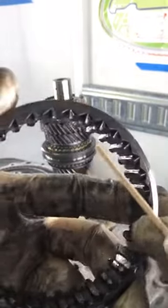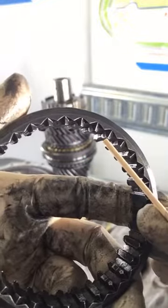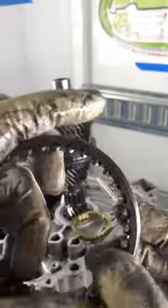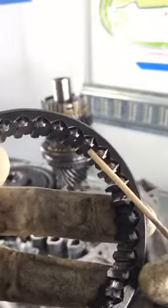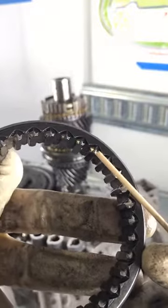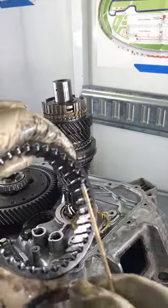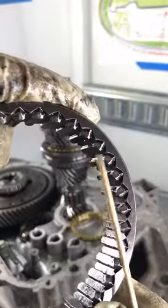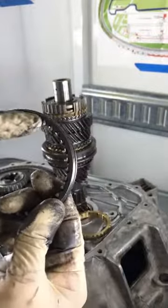Notice these guys are really sharp right here — that's the way they're supposed to look. If you flip this thing over, you can see where it's damaged. These guys aren't pointy at all, and so that's why it won't go into reverse. It'll go into fifth, but it won't go into reverse. It'll slide down this way, but it can't go across this way because these are damaged. And this is a common problem — if you can't get your shifter into a particular gear, chances are it's this sleeve right here.